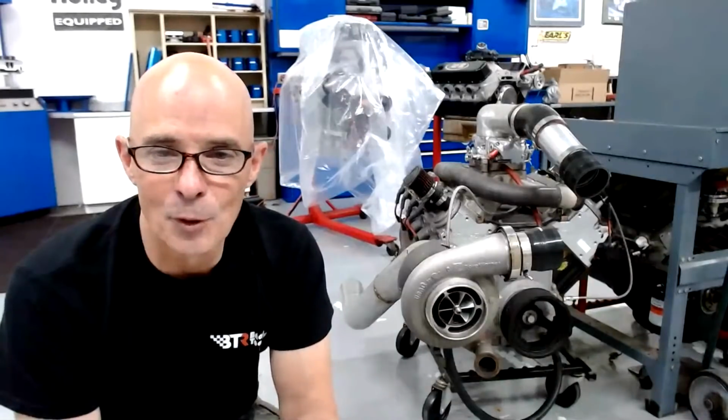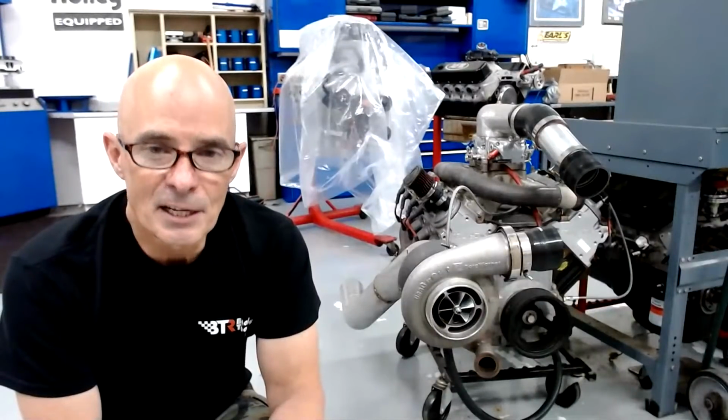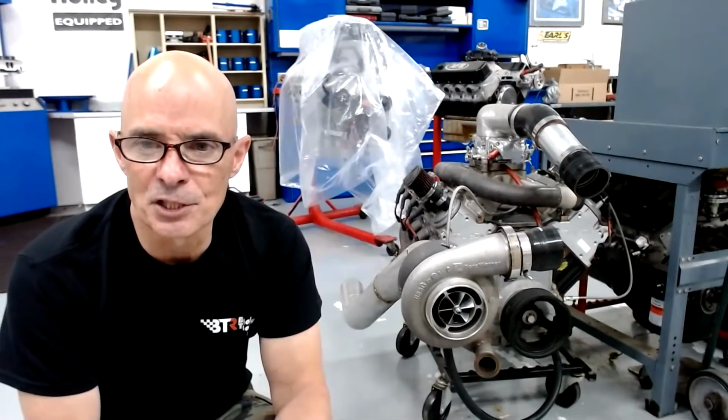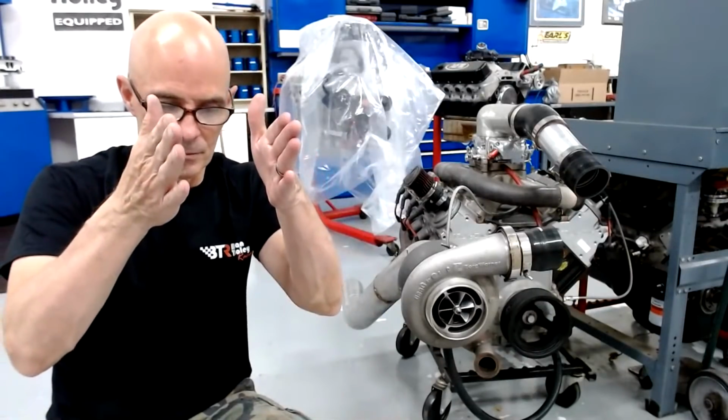Julius, how are you going to get that Ford motor to Australia? I have the custom intake manifolds that I did for the modular stuff, if you're interested. I can just send you that. Do you have a 5.4 base motor or a 4.6 base motor? These were done for the '03 Cobra heads, I think, and I also have a set for B heads. I did down leg runners, and then we had the dual plenums on it. So it's a fancy dual throttle body deal.